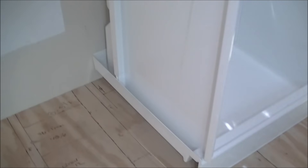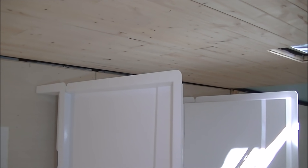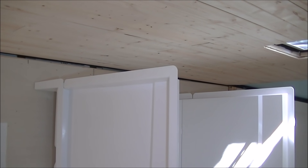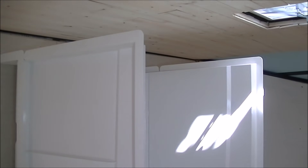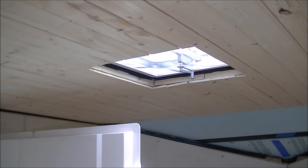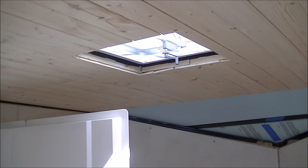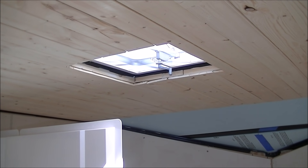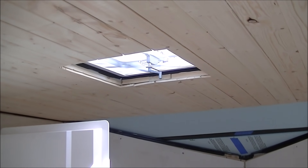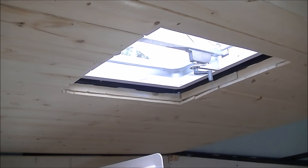We'll take each stage one at a time. You might notice the shower doesn't make it all the way to the ceiling — that's all part of the plan. I intend on leaving that area open so we can have circulation through there to help cut back on the humidity. We have a minor issue because we should have had the front ceiling vent offset a little more to the passenger side of the trailer so it would clear the corner of the shower.